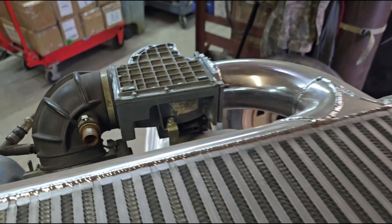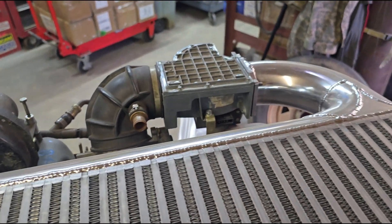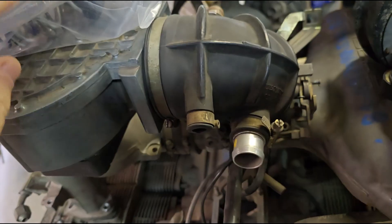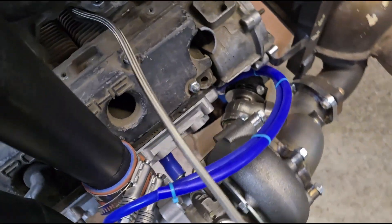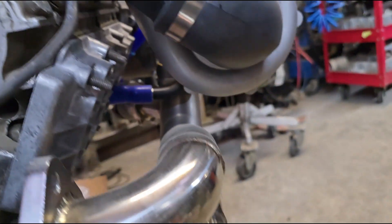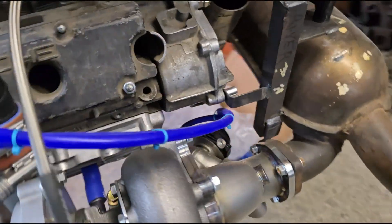Those are all non-intercooled. With an intercooler, these will end up running about 410 crank horsepower. These are all running on the stock DME, plumbing through the stock airflow meter. We will have a 3-inch replacement boot for any of the higher boost systems; for a stage 1 it'll still work with the stock unit. In the bag we have 25mm and 12.5mm hose plugs that go here and here to plug off so we're not pressurizing the oil tank. The oil feed is coming from the back of the block in the 930 location using a 3AN line into the turbo, and then draining back into the lower valve cover using a gravity drain and into the oil drain-back tubes.